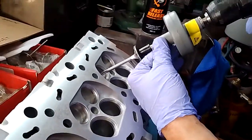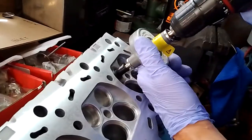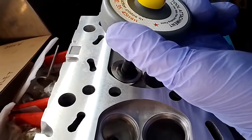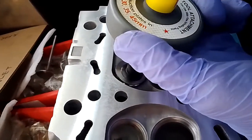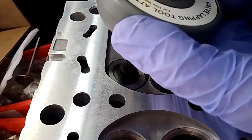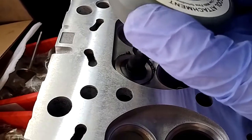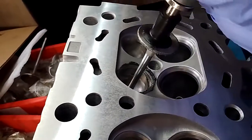You don't want to be lapping in your valve guide. I've set the drill on the slow speed because I don't want to do it too fast. I just grind it in, lift it, grind it. Every now and again let it spin a bit so you're doing a different area, and you can feel the friction — you can feel it grinding. It's about feel. Do a minute or two. When you lose that grinding noise, the paste is ground smooth and it's not cutting as much.